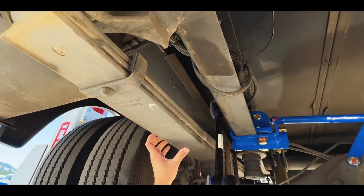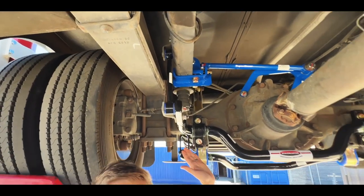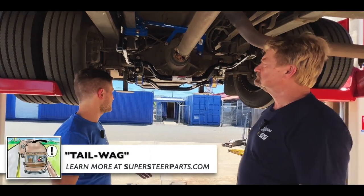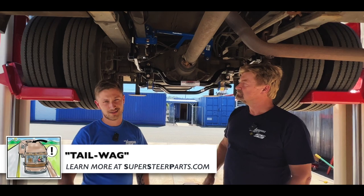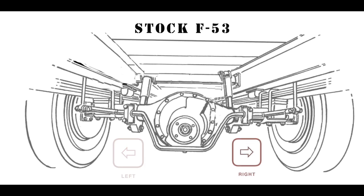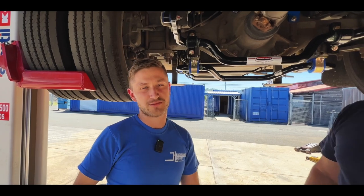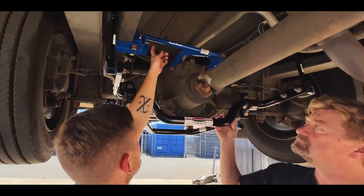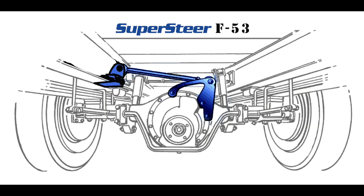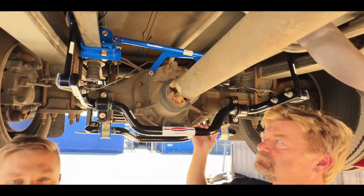These springs are pretty long and relatively thin, so there's a little bit of flex there. That small amount of side-to-side movement in the back axle translates to a feeling of tail wag. Especially on these F53 coaches — you've got a lot of overhang behind the rear axle and a lot of weight back there. That all wants to make the whole thing steer from the back, so you have to counter it at the steering wheel. That's where the track bar comes in: it allows the axle to move up and down, but does not allow it to move side to side, providing more positive location versus just the springs and spring bushings.